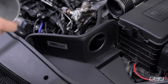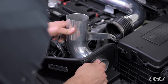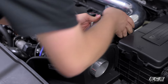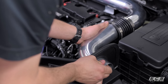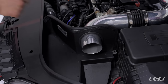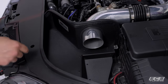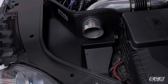The heat shield is now set in place, so we're going to install the lower intake tube. Insert it through the hole in the heat shield first, then twist the mounting tab down towards its mounting location and wiggle it into place. The lower intake tube mounts with a rubber isolator and two T25 screws at the front of the heat shield. Now we're ready to install our air filter.